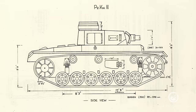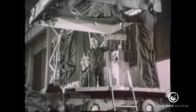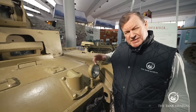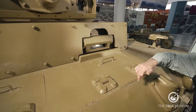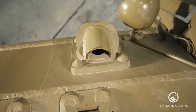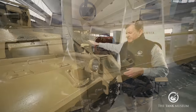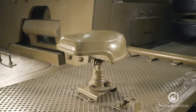Going back to basics, the hull is made in three parts: the whole of the lower hull is one component, and the upper hull is split into two — the Bugpanzer at the front and the Heckpanzer at the back. Both are of welded construction but bolt down onto the lower hull, allowing different armour thicknesses front and rear. Looking at the front of the tank, the glacis area — these are not hatches for the crew but access hatches to reach the front of the gearbox and final drives. There are also breathers, air intakes for cooling the steering brakes, standard headlights, and the Notek Tarnscheinwerfer — a tactical driving light that shines downwards and forwards but not upwards.